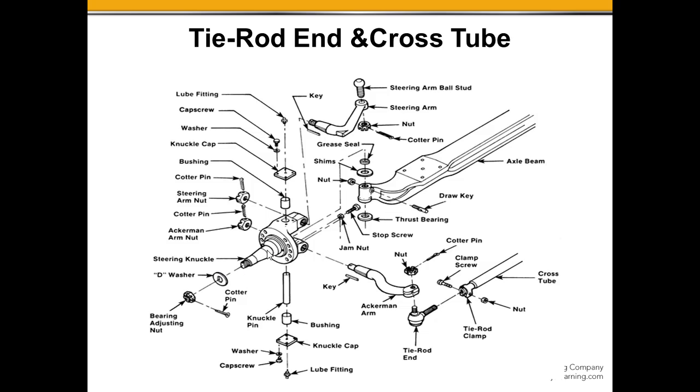So a lot of the wheel ends are supported by the steering knuckle, on the steering spindle on the steering knuckle. So although steering effort is used to move this steering knuckle at a different angle, we've got the steering axle coming across. So this is the I-beam axle, the spring mount with our leaf springs coming through here, attaching onto the suspension, and then coming out here to the end, the eyelet here in the end.